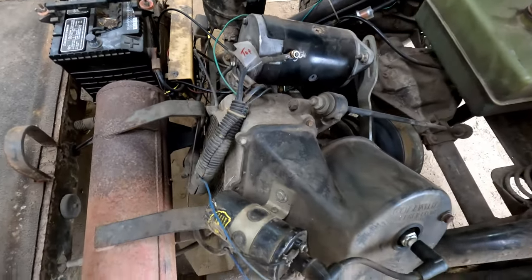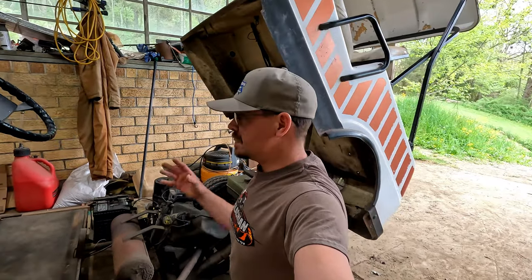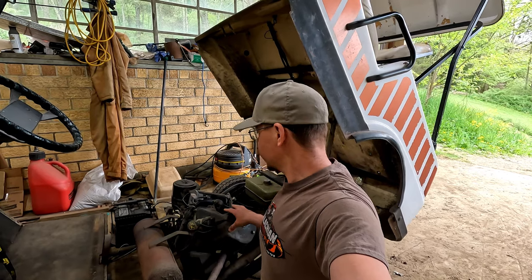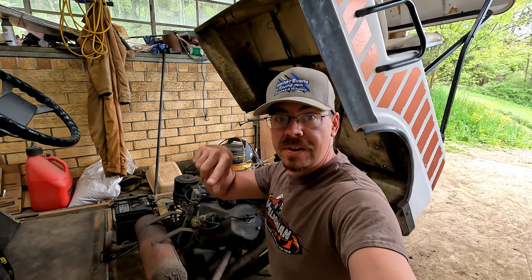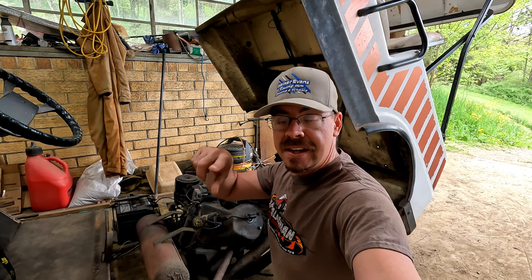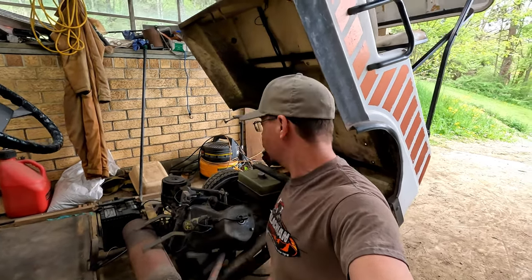It's a two-stroke hybrid, basically. And another interesting feature with these Par Cars is, because this is a two-stroke, for reverse, the motor spins backwards. So it spins in the regular direction to go forward, and then for reverse, it actually changes direction and spins backwards. So that's kind of a neat feature. Kind of makes timing these things, I guess, a little bit tricky.